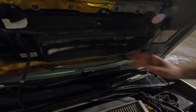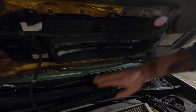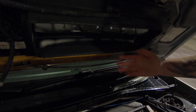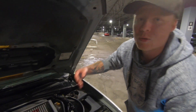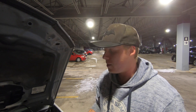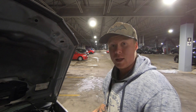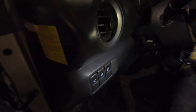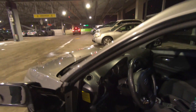The cool thing here is this little tube that's running — this is a water sprayer that's going to spray onto the intercooler. When it sprays water onto the intercooler, that allows it to stay cooler when he's launching the car or running at high RPM for a long period of time. It's a very good, cheap way to keep your stuff cool. You can see the little spray button there for the intercooler. The cool thing is that's actually a stock feature on the STI — I didn't know that personally, but it makes me want to buy an STI now.